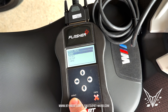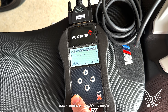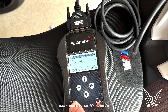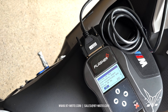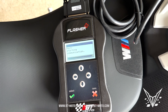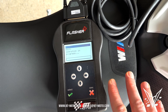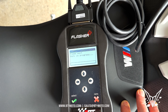Now we're back at the bike and ready to put that new tune file into the motorcycle. Go to Work, then Writing, and navigate over to the tune file. Select your tuning file — use left and right if you have multiple files. Now this is very important: make sure you connect the bike to a battery tender or battery charger. Some bikes take a very long time to flash. If it's flashing and the motorcycle loses battery, you would break the ECU. So it's very important to keep it plugged into a battery tender before and during this process.